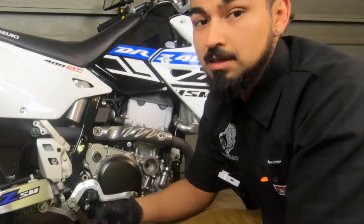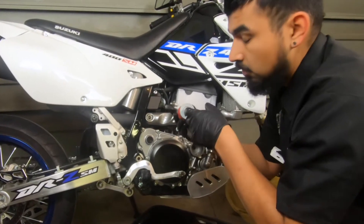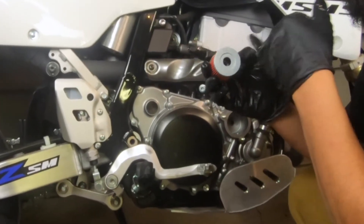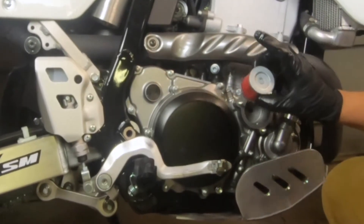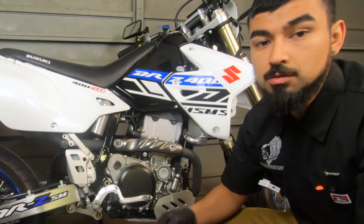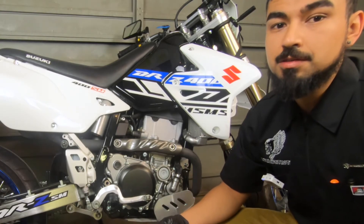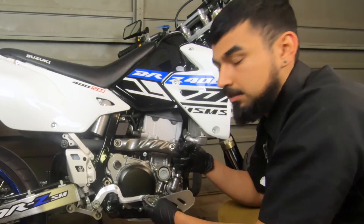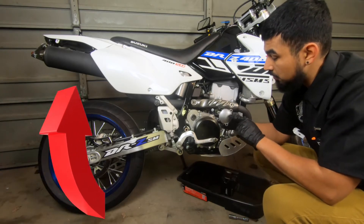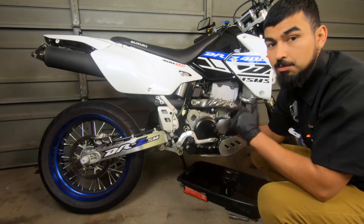When you're changing the oil filter, make sure that the part with the bigger hole goes on the inside. K&N always has the lettering on the inside, so point it inward. With your new oil, add a coating of lube to your new rubber gasket so it's nicely lubricated — it tends to stick better to the filter. Go ahead and apply the new gasket. When reapplying the filter cover, make sure the arrow points up — it only points up so you can't really mess it up, but make sure that small arrow points up.